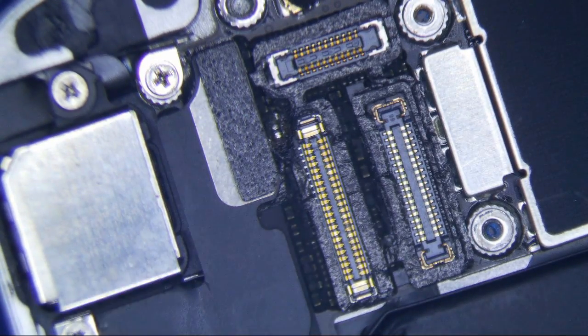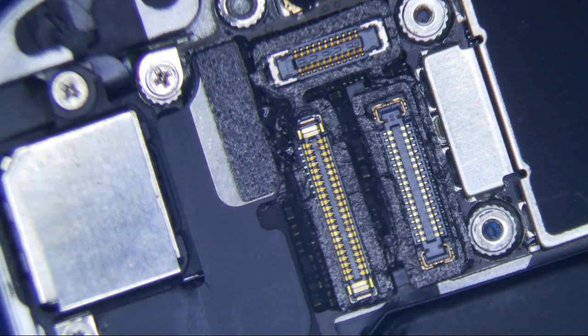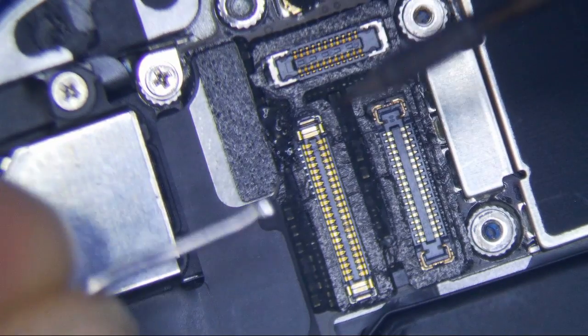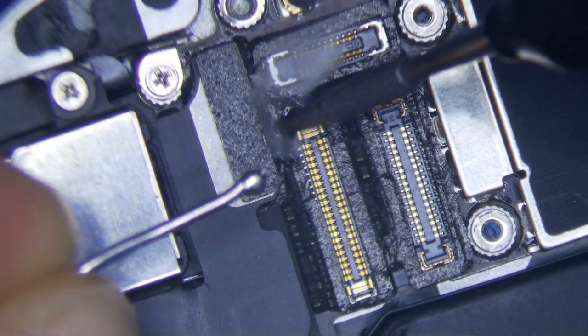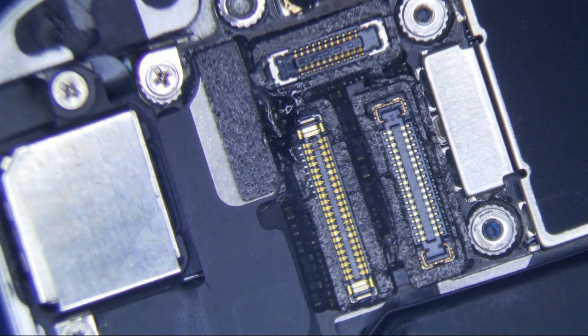99% of the time a backlight problem, there's that one component on a 6S. There's not really a whole lot to this. The 6S filter is 240 ohms, 0201, 350 mA.